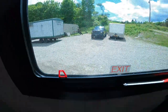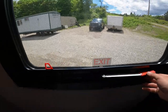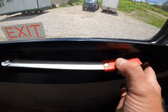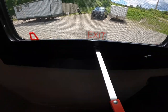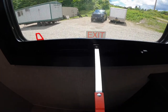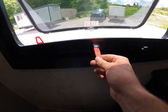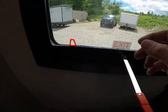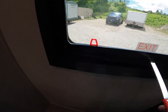Also on this side of the bedroom is the emergency exit. It's important to know how to operate it: press down on the black tab, push the red handle up and out, bringing the handle perpendicular to the wall of the trailer. Then push it all the way out until it is fully out of the RV. At that point, you can pull the red tab on the screen to remove it, and you may escape to safety.